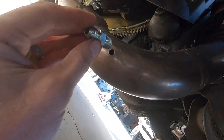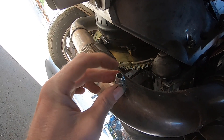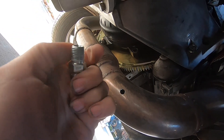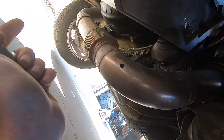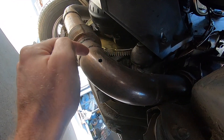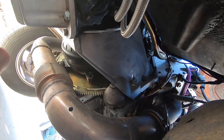Got a hole drilled. We'll stick this fitting over the top and weld it up — that'll be my pressure output. I'll clean this up, grind it down, and clean up whatever's on here. I need to jack the car up a bit more because I have zero room, but then we'll come back, clean it up, weld that thing on, and we're good to keep rolling.